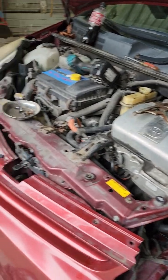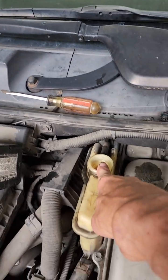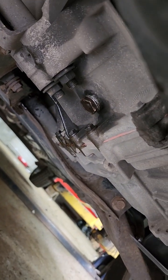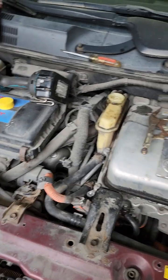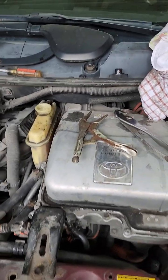The first thing you want to do is open your hood. Take your cap off of your hybrid cooling system. Then you raise your car up and put a catch pan underneath it. Remove that plug and allow the coolant to drain into the pan. Once all the coolant comes out, put the plug back in and you're done underneath.